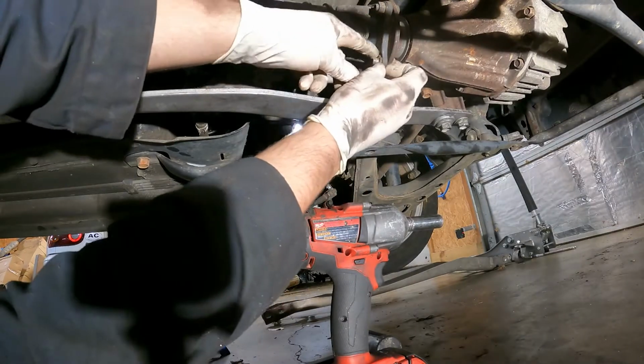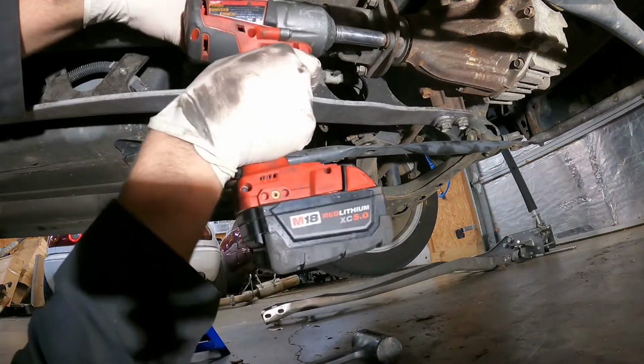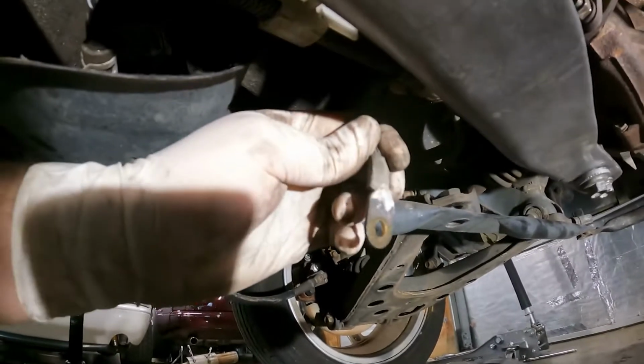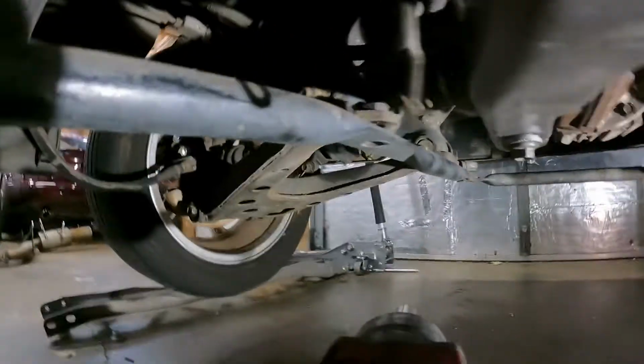Make sure you tighten these. You really don't want to have these come loose on you. And as always, nut and bolt check everything you do on your car after you've driven it a little while. Alright, use this opportunity to clean up the PPF ground. It's a 10mm bolt. It attaches right to the side of the PPF. Once you're finished with that, go ahead and snap the wiring harness back into the side of the PPF.